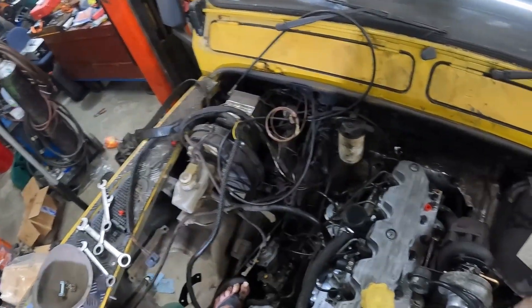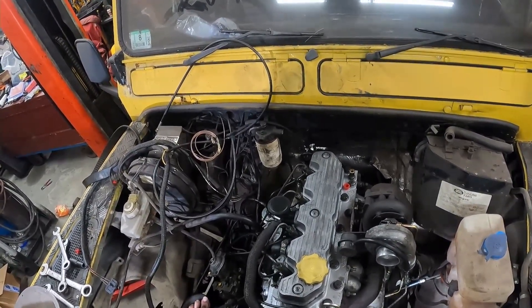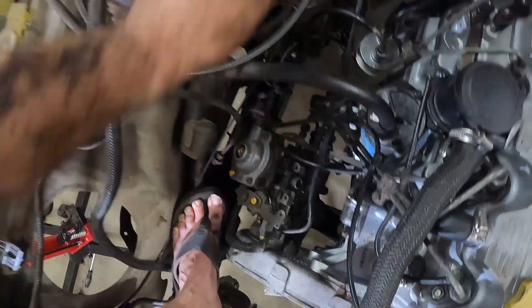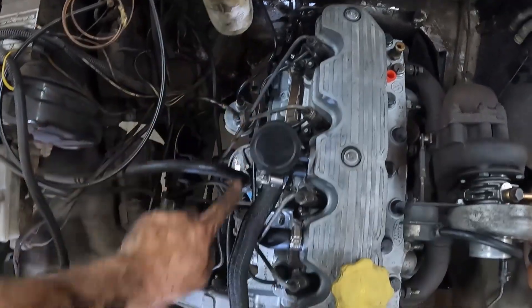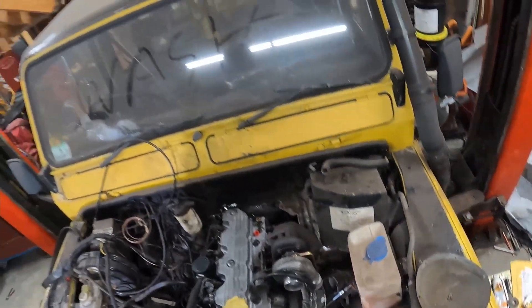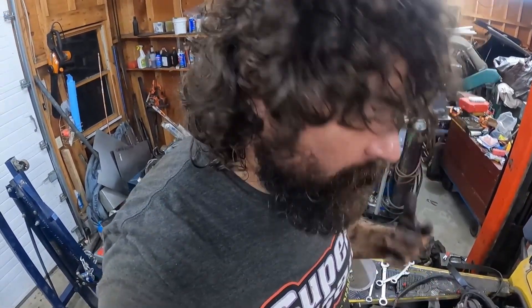That was all I wanted to do today. I guess I can do electrical tomorrow — I have to hook up one wire to the fuel solenoid. I'm just going to hook up the pressure gauge. The one wire for the glow plugs, and then the starter. I can leave the alternator wiring until after it runs because that's all she's got. It's so simple. Which is good because so have I. Simple, that is.